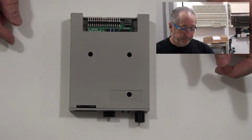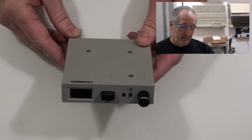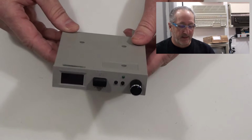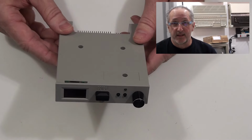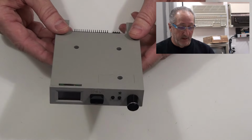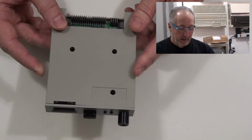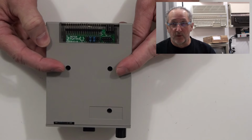I'm going to show you before we eventually get to the computer, and I'll demonstrate it working for you. But first, I'm going to show you the Gotek. So this is a gray version of the Gotek that I can use. I think it's actually the first actual Gotek that I tested with. No, it's not. It's a 435. It's the one I got afterwards. I was actually testing the STM32 first because that's all I had at the time. But this one is a modified firmware, updated version of it. You can probably see the jumper settings. Those are the jumper settings for the FD-2000 or FD-4000.